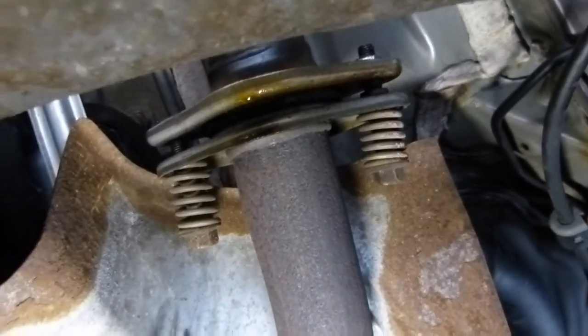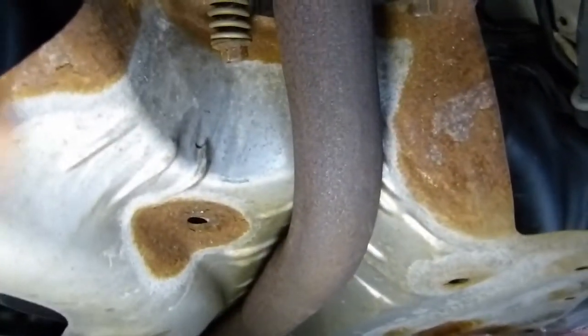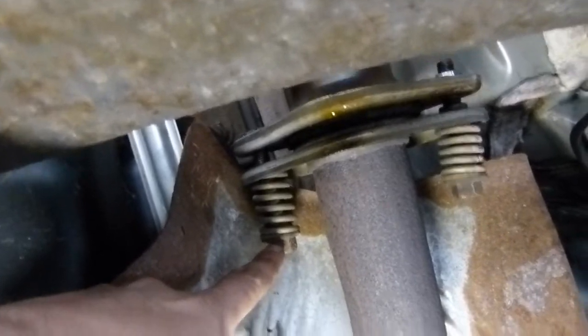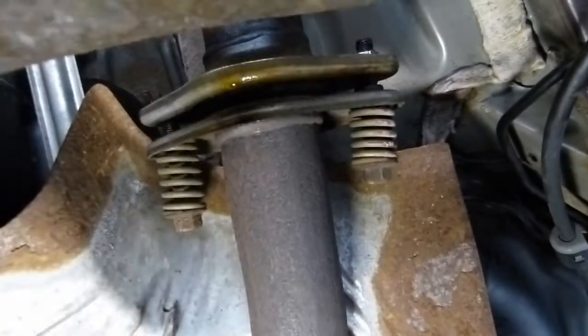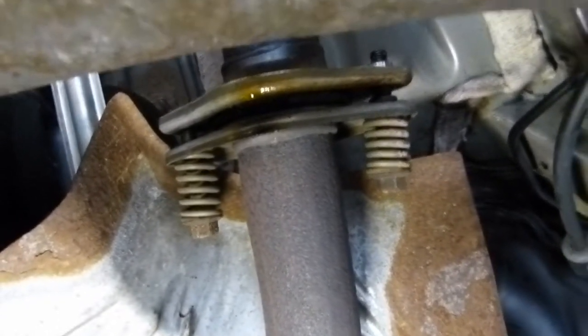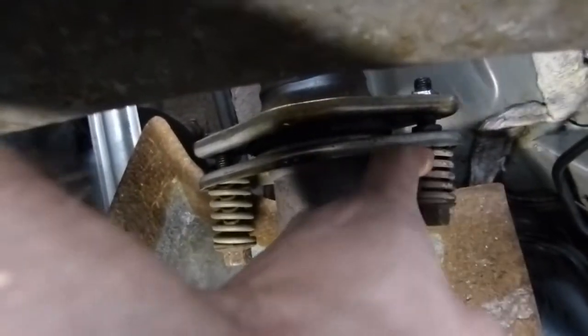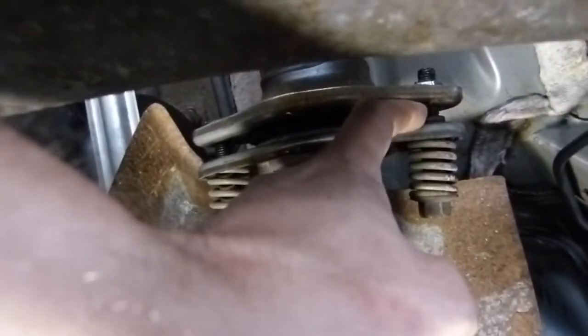I've run into some technical difficulty trying to get the heat shield off. I took the front three bolts out — those came out more or less easily. To get it off the exhaust pipe I had to loosen these bolts here. One side gave me no trouble, but the other was real tight. On the top side of the flange there's a square nut welded onto the flange, and about halfway through loosening it, the square nut came unwelded and broke. So it's now spinning freely. I tried vice grips but can't hold it tight enough — it's just clogged with rust. I'm going to use a cutting wheel and cut the bolt right here, then put new ones on.